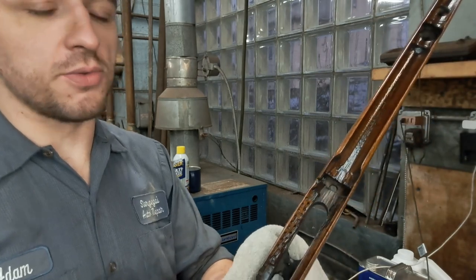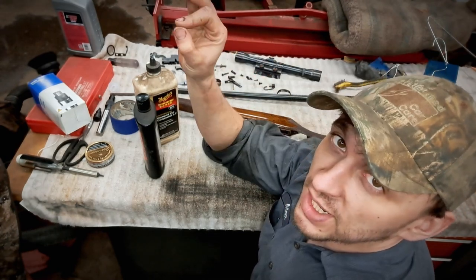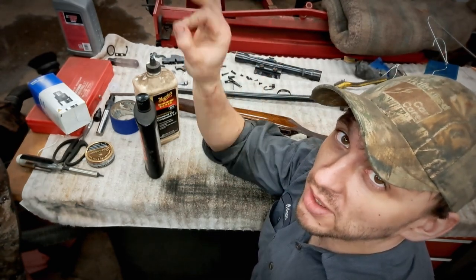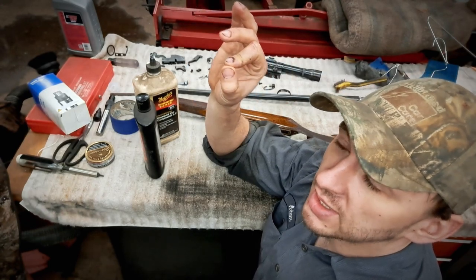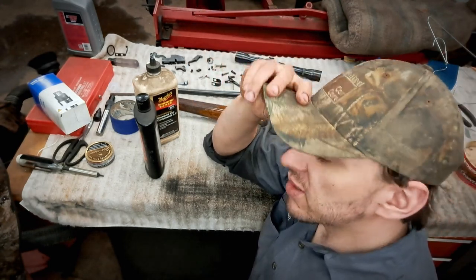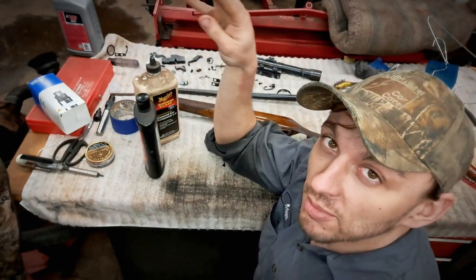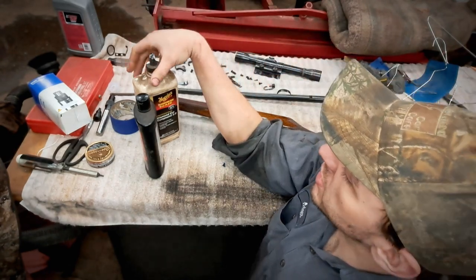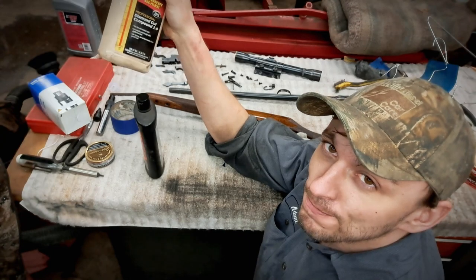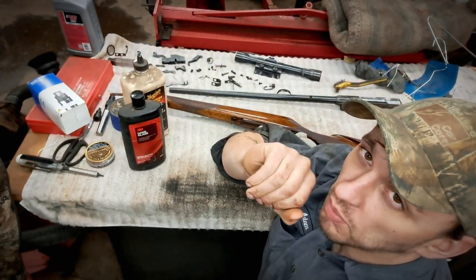I'm going to get this dried off and wiped off, then go to the bench and polish it. If you're going for a high gloss finish, there's a chance you're going to burn right through your finish when polishing. When you first begin, use something a little more coarse and work your way down — it'll start off foggy, and the more you polish the more shiny it gets. I'm going to be starting with Meguiar's diamond cut, then go to hand glaze, and after that just do a wax buff.